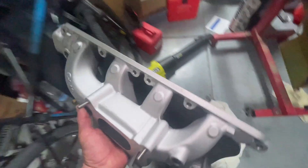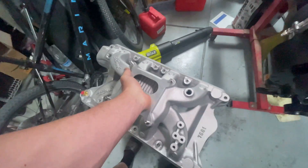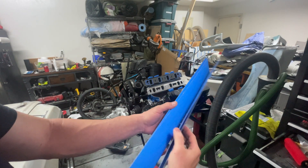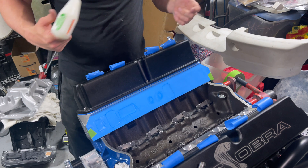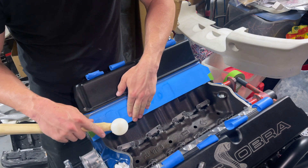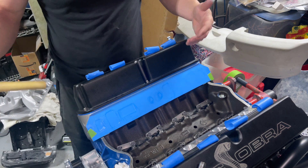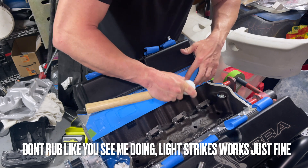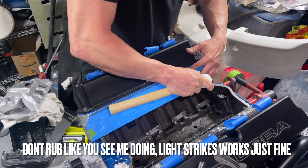On this RPM Air Gap, you can stick your finger in there but you can't see where it comes out on the other side, and you can't see through it when you set it down on your heads. I just got some cheap poster board stock from Walmart to make my templates. My first set I tried using a plastic mallet to avoid damaging the heads, but that didn't give me a crisp line — a lot of trimming with a razor blade and a big pain. I slapped down another set and used the ball peen hammer, just real light, and knocked out a complete set of templates in about two minutes. Don't do what I did first — use the ball peen, you'll get much better results.